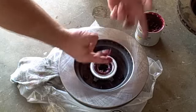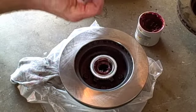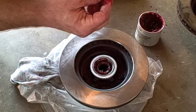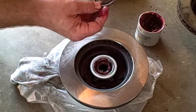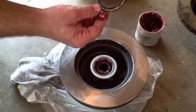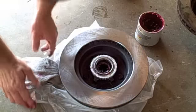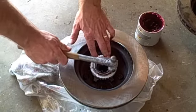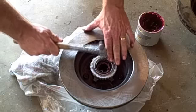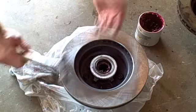Place the bearing face down. Then grab your seal and inspect it — make sure it doesn't have any dings or dents, because it rests right on the spindle. Sometimes dirt or rocks can bend these, so if it needs replacing, do it now before reassembly. This one's okay. Line it up and use a little hammer to tap it in — these bend easily, so be careful. It only needs to go in about a sixteenth of an inch. You can tell when it's all the way in. Then take it over to the car to install.